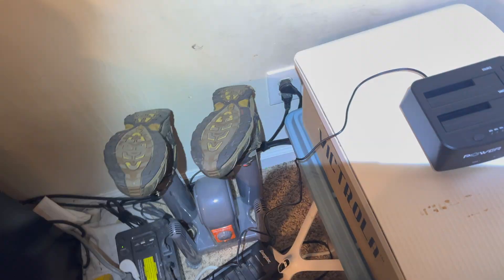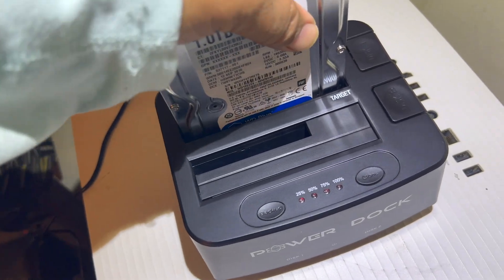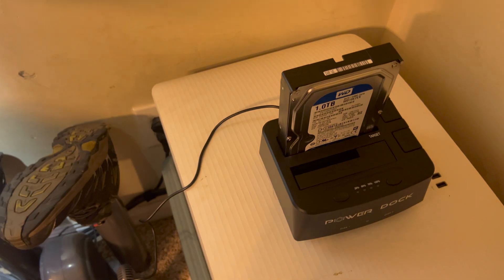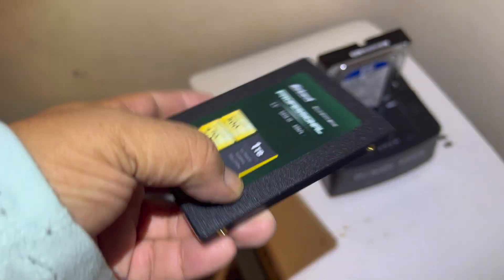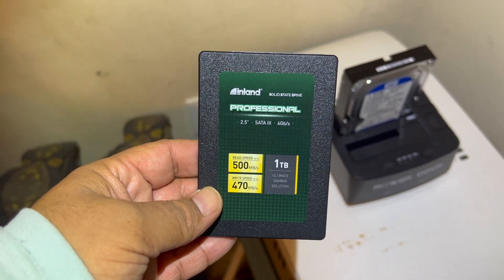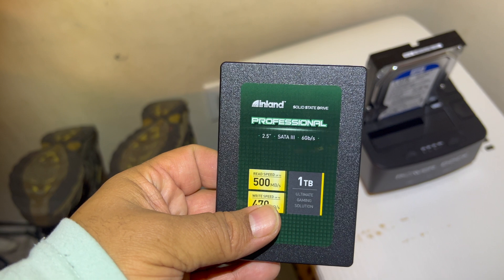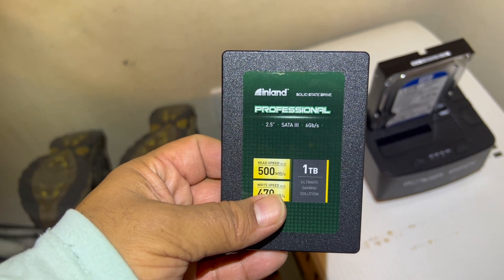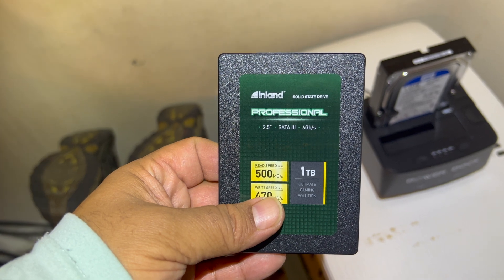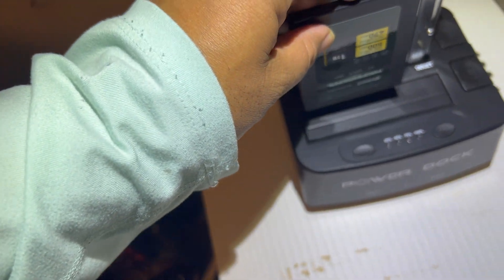You should only be able to get the drive in one way. Let me go ahead and put the Western Digital Blue in there — make sure that's in right. I'm going to be cloning that to an Inland 1TB solid-state drive. I've used these before on older systems, and they are so fast. It took a system that would boot up in about 30 seconds and had it booting up in 6-7 seconds, and from the time you hit enter with your password, it was about 4-5 seconds and the desktop was loaded. It was so responsive.